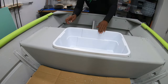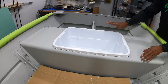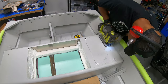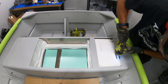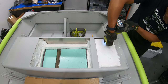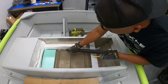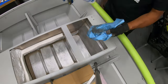Perfect fit — look at that! This whole deck will be framed off this live well, so its height determines the rear deck height. After the initial fitting of the live well inside the rear bench, I tested the elbow through-hole fitting. Using a one-inch hole saw, I created pilot holes, then used a jigsaw for accurate, clean, straight cuts. Then I removed foam using a reciprocating saw — cuts around the perimeter and a crisscross cut in the center to remove foam in big chunks. I noticed the aluminum underneath had a lot of brown soot, so I grabbed my orbital sander to clean it up.